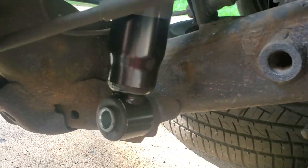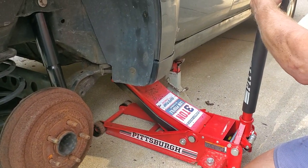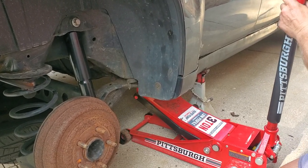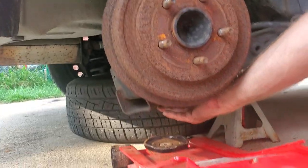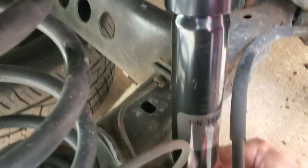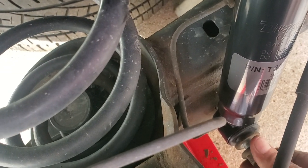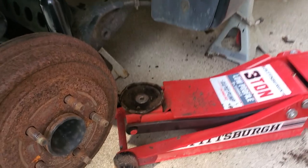So now we're going to go ahead and jack up the suspension. We'll get this old shock out of the way. Jack the car down ever so slowly — I've got all my jack stands, I've got everything here. The car's a little bit old, a little bit rusty. We go over here and get the jack underneath there — I think I'm pretty much in the middle. Jack that up just enough so that way the bolt is going to line up. We go up a little bit higher — actually we're a little bit lower, so let's lower. There we go. Actually I'm not even holding it up with the jack at this point.